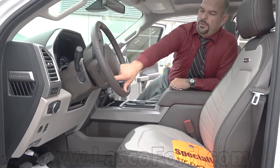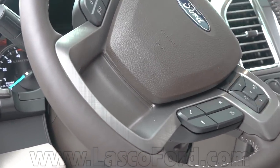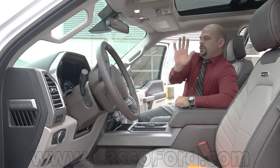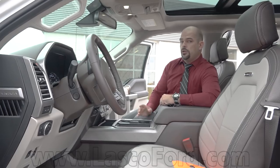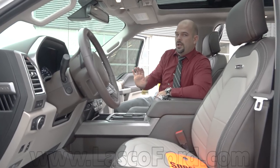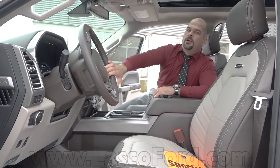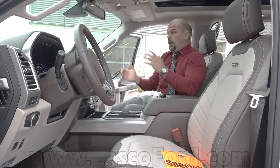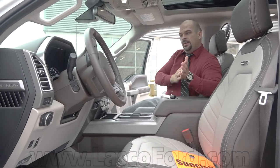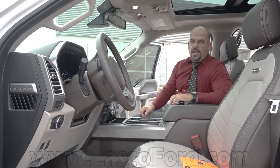One last thing: if you have a Super Duty and you see this little protruding area below where your horn is, below that is an airbag, and behind that airbag is an auxiliary gearbox. When you go to turn a dually and back it in, you don't want to look like Austin Powers in a golf cart. This auxiliary gearbox minimizes your effort — you turn three-quarters of a turn on the wheel and it turns your wheels all the way at slow speeds. At a high rate of speed, it doesn't allow you to overcorrect. If you yank the wheel for a deer, it minimizes the impact of that sudden correction. As you speed up it's for safety; as you go slower it lets you whip around a parking lot like you're driving a go-kart.